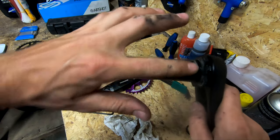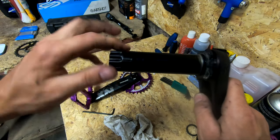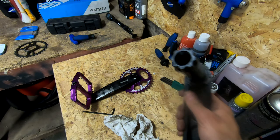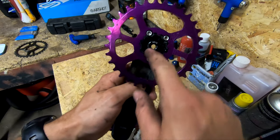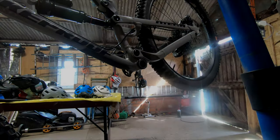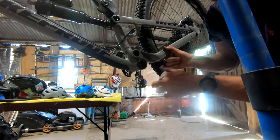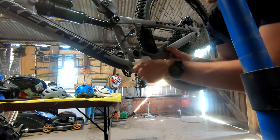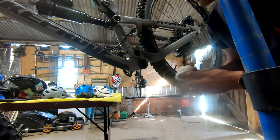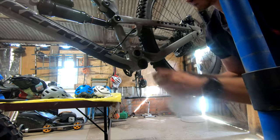We also want to put a bit of grease on the end here where the bearings are going to sit, on the end there, and inside the thread of this side. Same on the other side - a bit of grease inside here. Before we put it all back together, give the bottom bracket a bit of a clean out, a bit of a wipe. Check the bearings, make sure they're nice and smooth and free rolling. If you need to replace them, find a video or I can make another video once I need to replace mine.